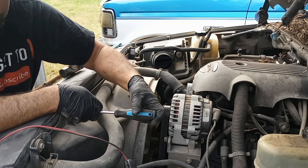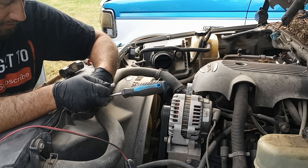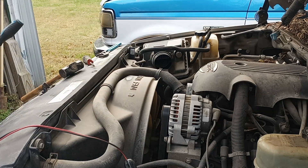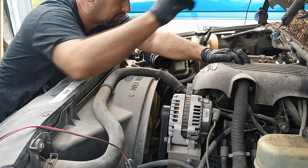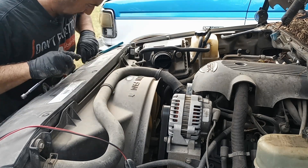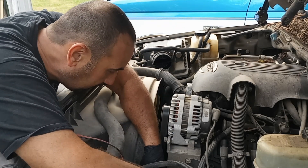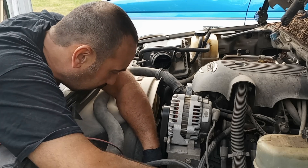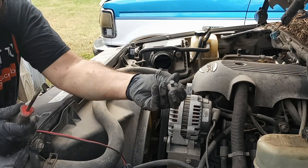Let's get the water pump done — make sure we don't keep losing antifreeze. I can see water coming out of the water pump, but that doesn't mean I still don't have the head gasket problem. Hoping I don't. There should be some plastic clips down here, we'll pop these off. I don't have the fancy tool — just taking a screwdriver and prying them up, just pry them up and they'll pop out.